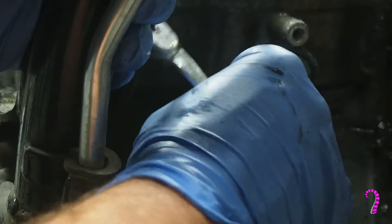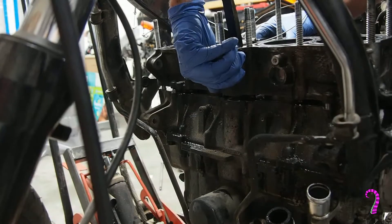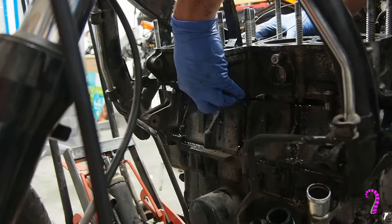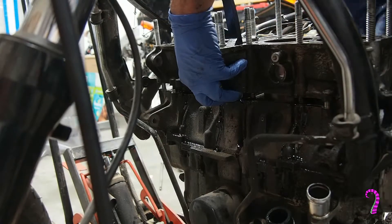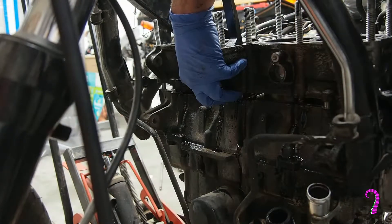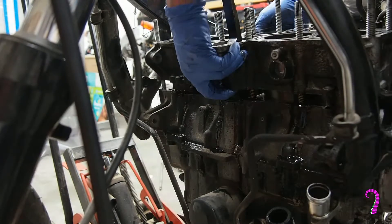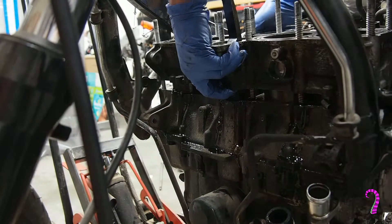It's very easy to overlook, so make sure that you remove this bolt before you try getting the cylinders off, or else you're just going to end up in a world of frustration. Once you remove that little tiny bolt you can remove the cylinders the same way. Just be careful if you're dealing with questionable rings — they might want to kick out some debris as you pull these off, so try to keep a rag underneath them.